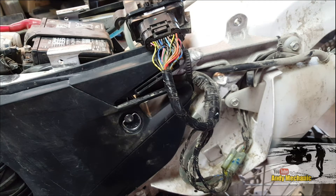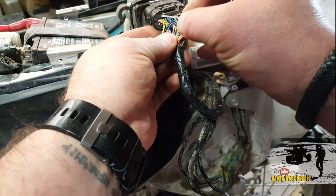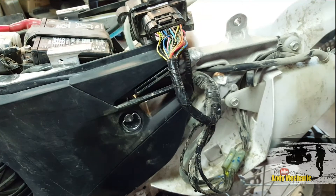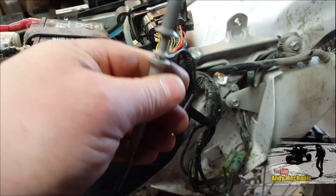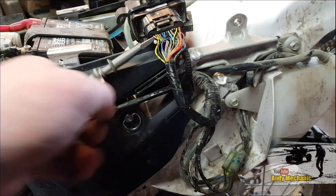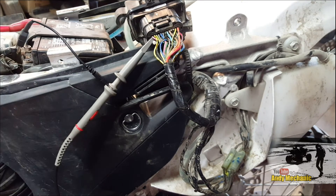So we've got here the intake air pressure sensor, otherwise known as a MAP sensor, and it's the pink wire. I'm just going to back probe the pink wire — you should know what back probing is by now. That's the pink wire just there, really easy to get to. We're going to slide that pin through the little rubber grommet bit that's in there. Make sure it's all the way down to the bottom. Then very simply you just get a little probe, open up the probe and it will clip onto that pin. Then put the earth onto the battery negative.